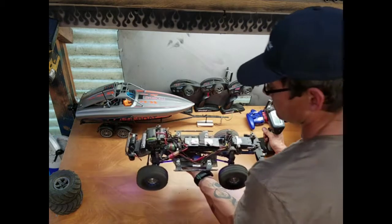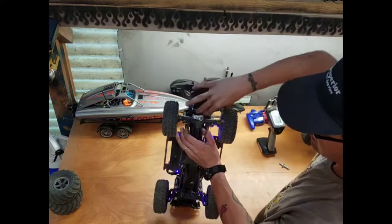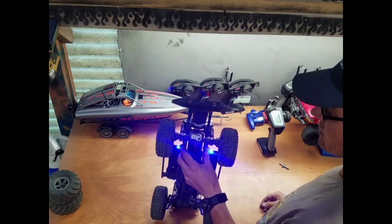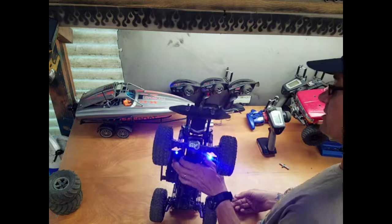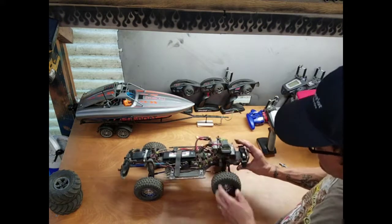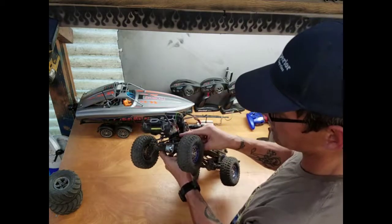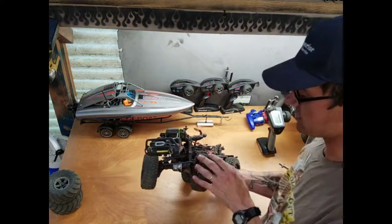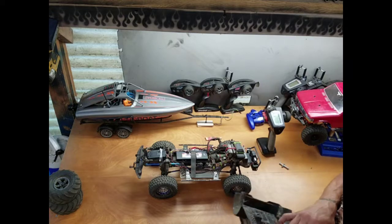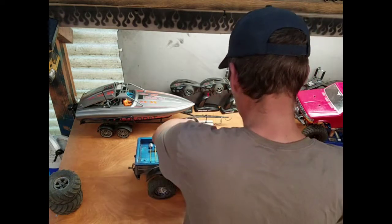The sound kit controls are super simple — just two buttons. I've got it mounted using a servo mount from when I put four-wheel steering in this truck, literally just zip-tied on — it moves around just a hair but doesn't flop or rattle. I'm running STRC front shock towers because with the 500 oz-in Savox steering servo I was having problems with deflection on my panhard bar — the steering is now much more positive and solid. Really worth it.